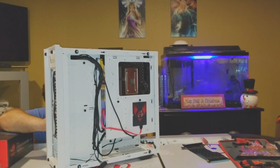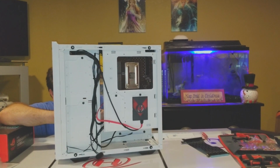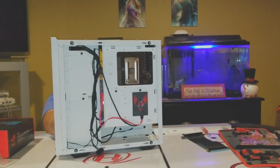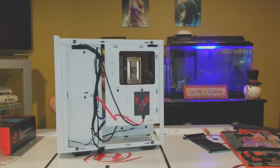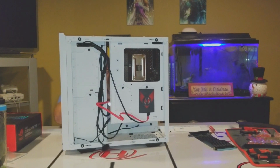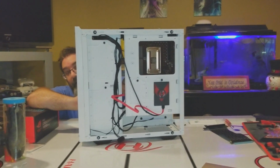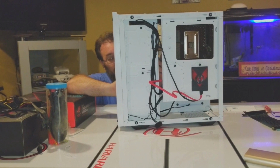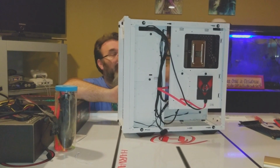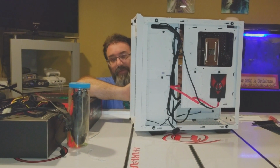Now, there's not really a set order of what you have to connect this to. You can connect it pretty much any of these that you want to. I'm going to go ahead and connect it into the serial ATA connector 1. Like I said, there is a total of 7 serial ATA connectors here. There's 6 on the side, then there's one that's a vertical. It's supposed to be for another external, and then another external on the back here, so a total of 8 actually, but 6 or 7 of them right here.